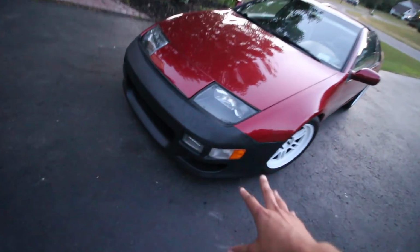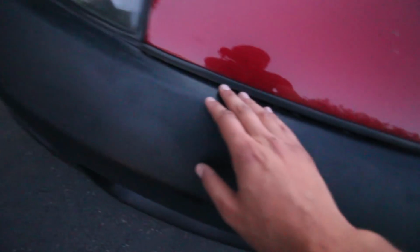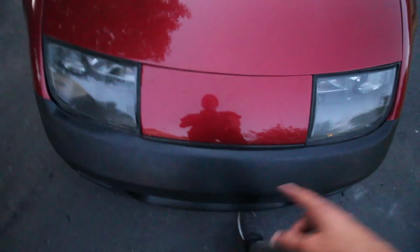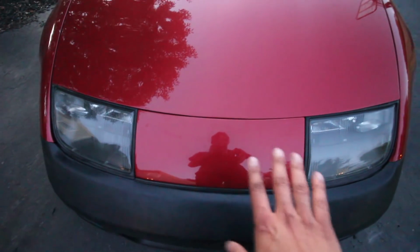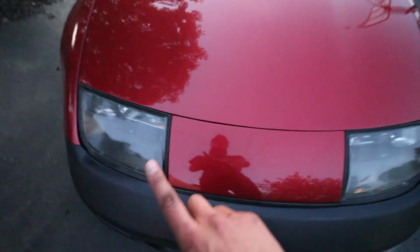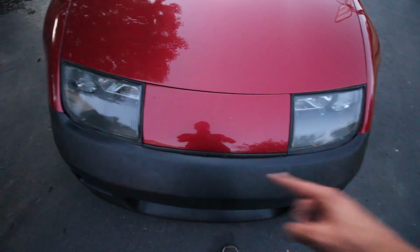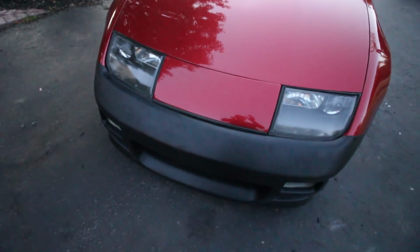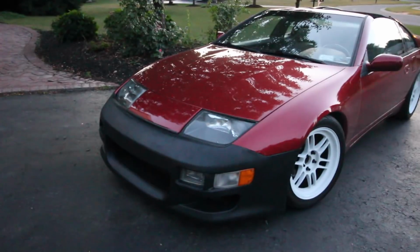I'm glad we went ahead and spent some time and got this thing fitted up. As you guys can see, I'm having some issues in here, but that's only because under here there's those two brackets, the main bracket that holds the supports up in the bumper. I wasn't able to bolt those down because they actually need to be moved over to the passenger side like 3/8 of an inch. So I have to take everything back off, drill the holes out a little bit over that way so it can shimmy over, and then things should line back up, and then hopefully that gap will no longer be visible, because you can kind of see the bolt and stuff in there. I don't like that. Kind of hard to show up on camera, and plus it's really dark out. But all in all, little adjustments that need to be made.